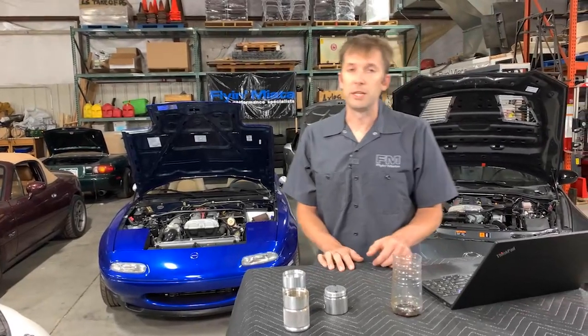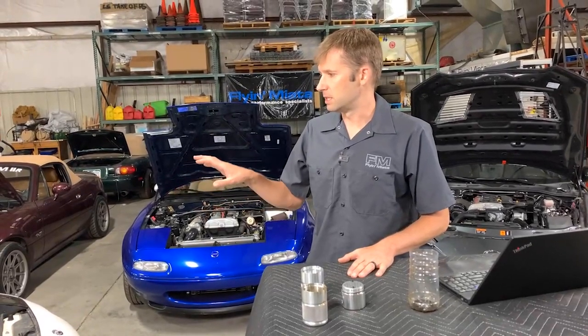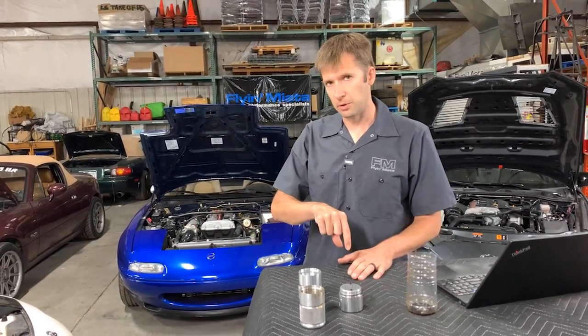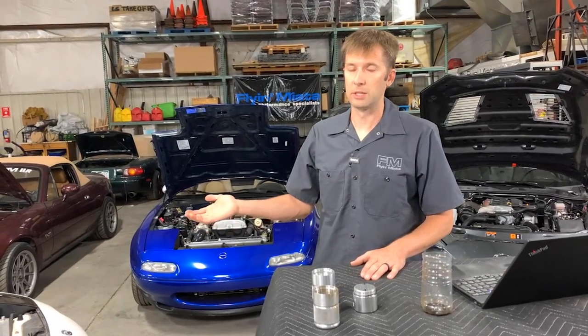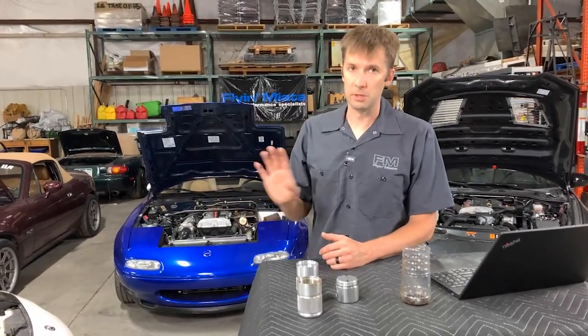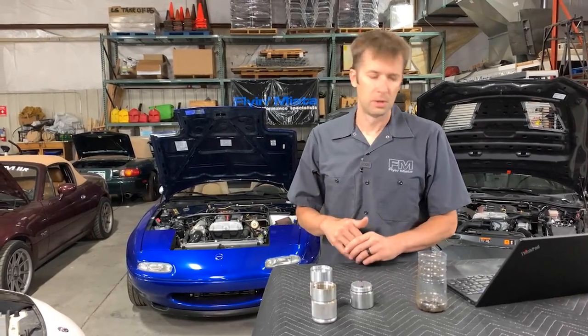Question: should I still use my PCV? Absolutely. The PCV is intended to keep pressure from flowing into the crankcase from the intake manifold. If you have a boosted car, you really don't want to pressurize the crankcase — and the PCV valves are not spectacular to start with. If you've got an NA or NB, definitely upgrade to our turbo-specific PCV. But regardless, short version: yes, leave it in there. Mazda intended it without a catch can. The catch can serves a different purpose, so leave the PCV in.